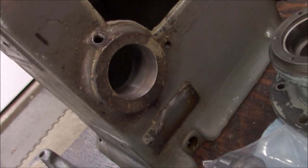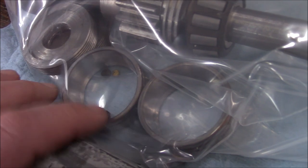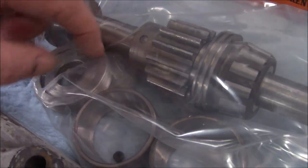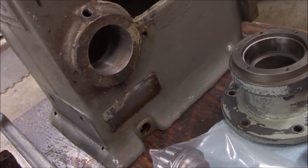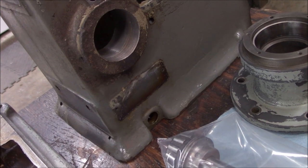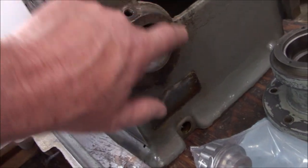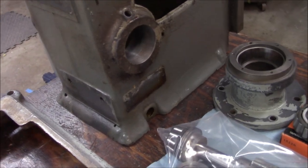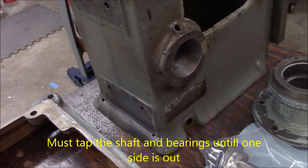Here are the bearing cups. These go in facing each side and then you've got a couple of retaining plugs. The fit for the cups is pretty dang tight, and combined with the dry grease it was difficult. As you can probably see the discoloration here — I had to warm the case up with the propane torch and then tap tap tap, taking my time. Finally got them to come out, squirting penetrant and easing them back and forth. But man, they were tight.